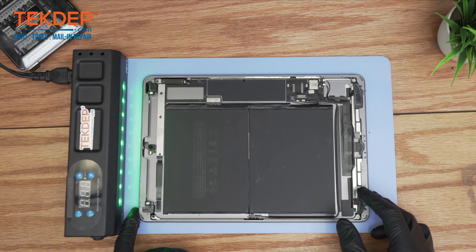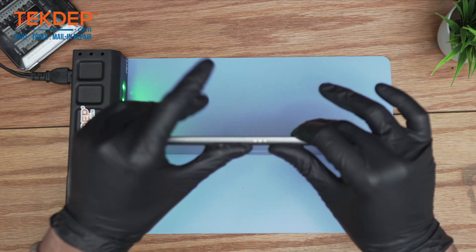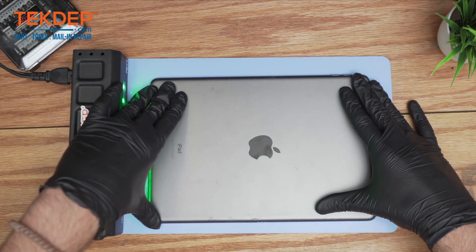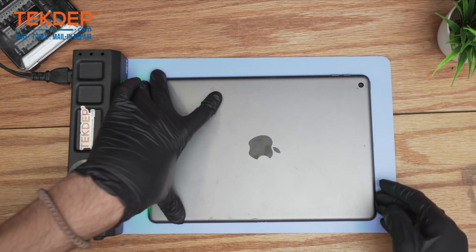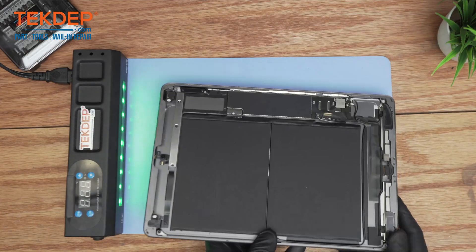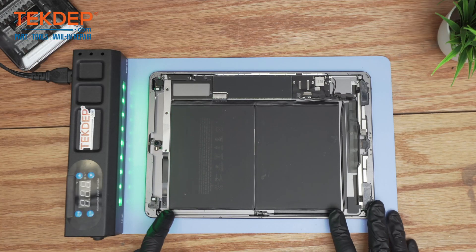After finishing cleaning up the frame, you want to make sure that dent is flat. Just put your right thumb and left thumb right here and simply twist it — make sure it sits flat. To verify it's perfectly flat, put it in this position and make sure there is no open enclosure anywhere. iPads have this infamous issue called 'bend gate' across all past generations, so always examine the frame before giving a quote for the digitizer repair.